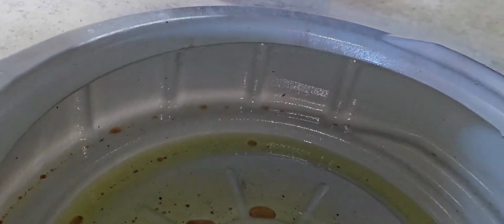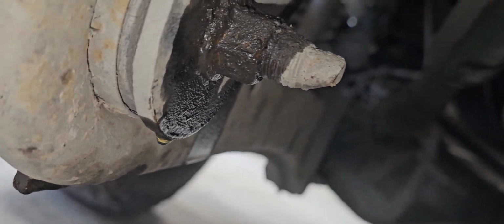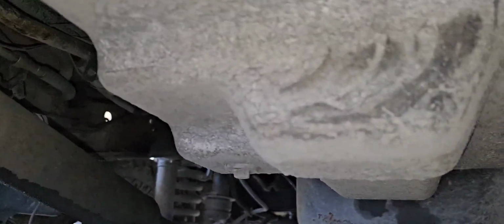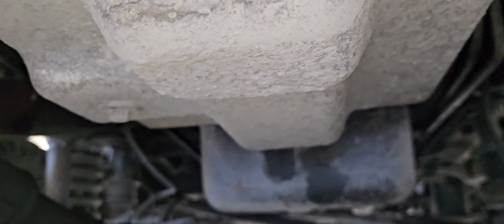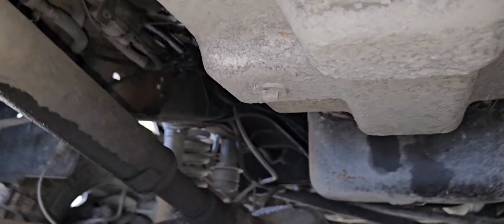But I don't tighten mine so crazy. See, you got water in there. See the brown smut? That's water. I've been getting a little, like, stutter at low RPMs, and came to the conclusion that it's water. And the fuel truck usually tells me. That didn't tell me this time.